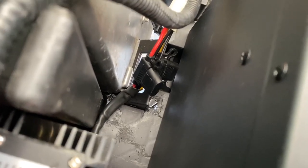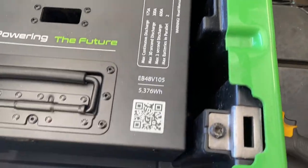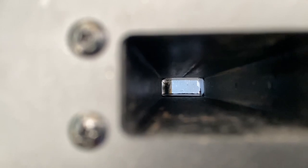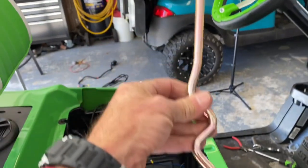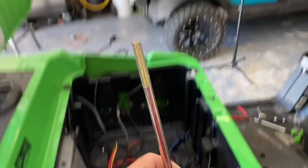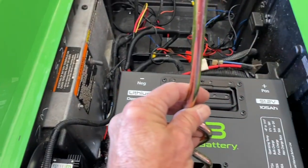I've got the battery set in place. Remember that little notch down there? That's the notch I cut out. The reason I cut that notch out — your battery is shifted all the way forward. If you look down the hole, look where your rod is. Your J-hook has to hook to that rod in order for that rod to be centered. So if you don't want this to mount at an angle, I would suggest to snip that off — it doesn't take but a second.